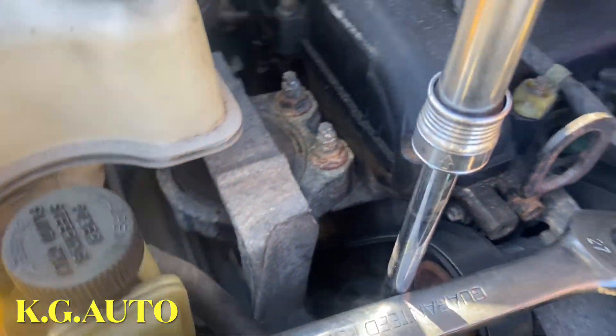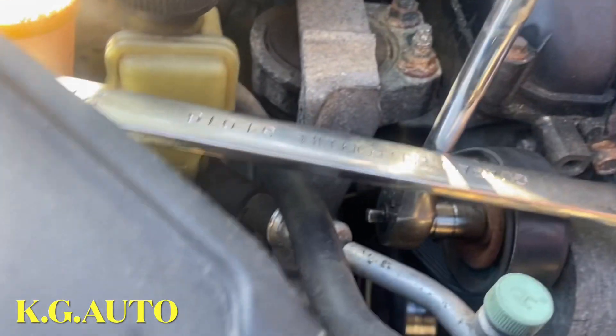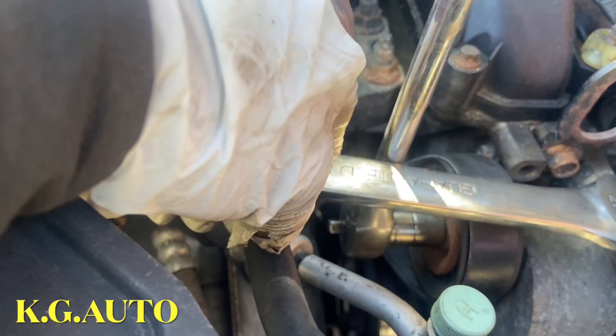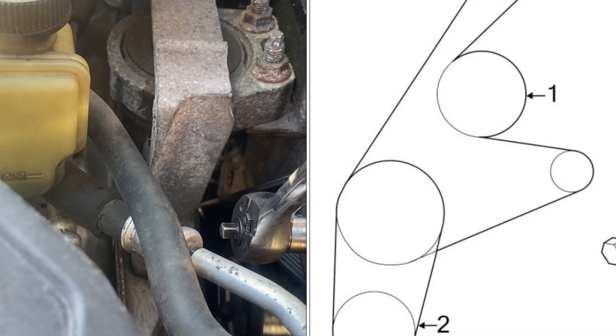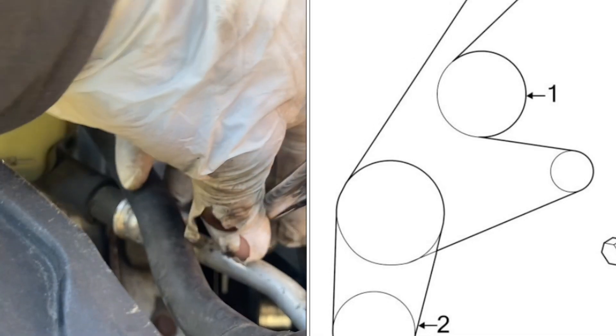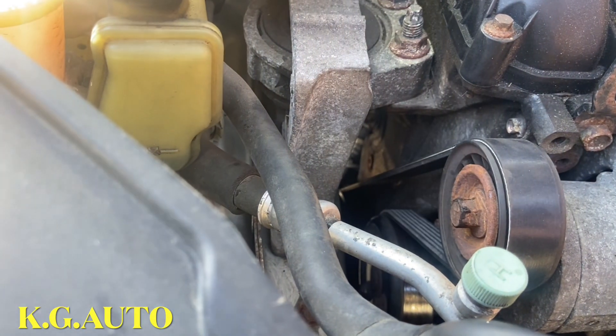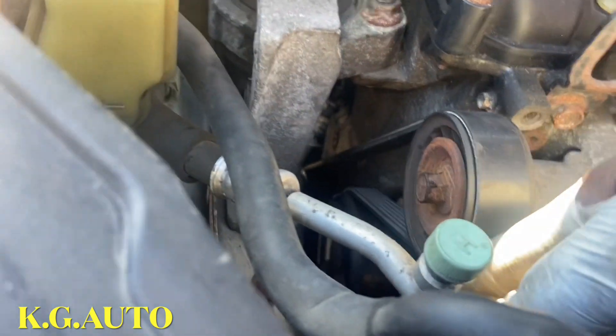As you can see, the belt goes all the way. Let me come underneath there to show you — see right there? That's it right there. Now I'm going to use this technique — it's going to be good. You push this, then you release this tensioner. Once you release it, it gets tight. That's a nice tip for anyone who wants to do it. Subscribe to your boy now.